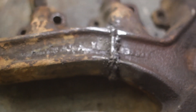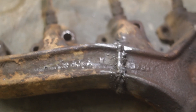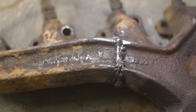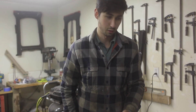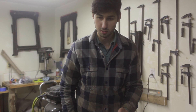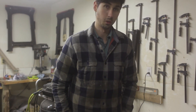So if you wonder if you can weld up your cracked cast iron manifold - you can. It's not the kind of thing you probably want to do on anything you want to look nice, but if it's a hard-to-find manifold you can't just go to the junkyard and pull one for ten bucks but you need it to work, then go for it. Flux core definitely works better. I actually turned down the gas on those last few welds, so if you've got a MIG set up, it seemed like it helped make a smoother bead - I had some C25 mix in there with flux core and it worked pretty well.